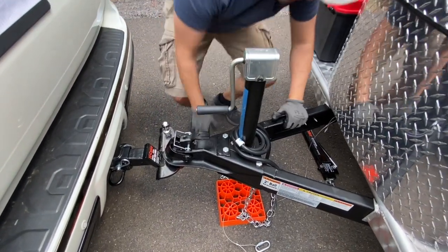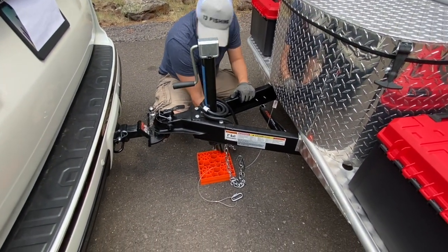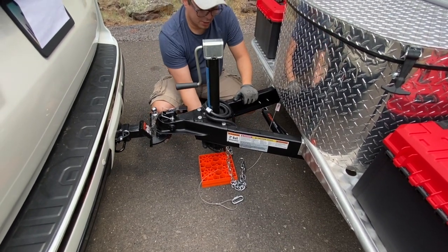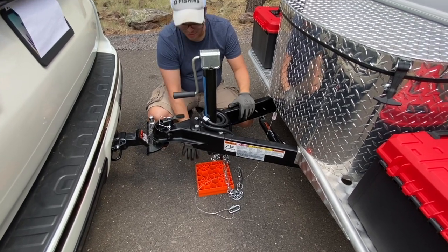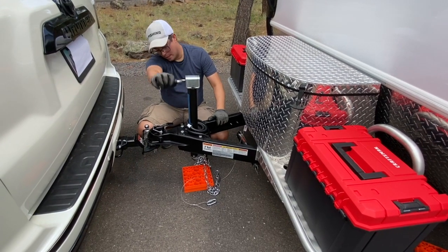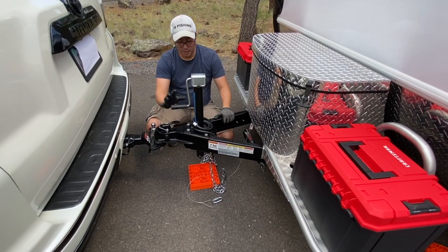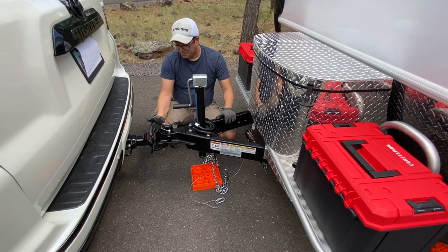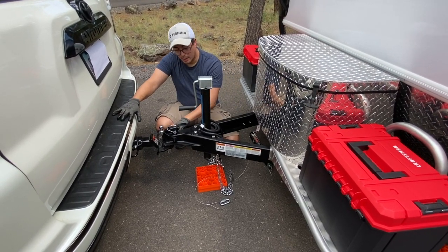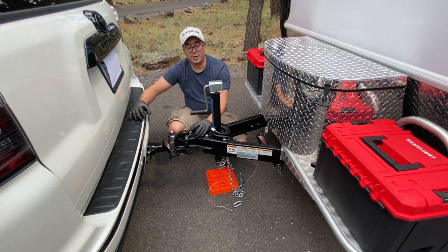I like to use a couple of orange Lego pads for the jack so it's not sinking into the asphalt. With soft asphalt in campgrounds or when it's warm, the asphalt gets pretty warm and the jack itself will bury inside of it or start bending — we don't want that. This will keep it nice and level and clean. To lower the jack, go ahead clockwise — it's going to take some time to get down there. Once you lift this up, the tongue will come up off the car and the ball joint. Then you'll have enough space and access to pull away without hitting anything. That simple.